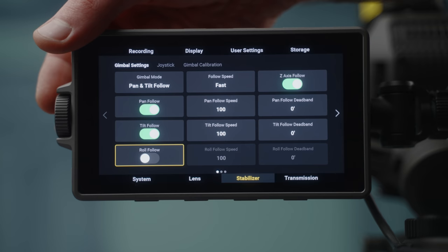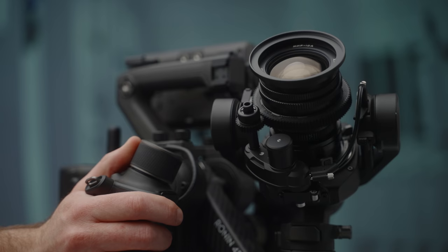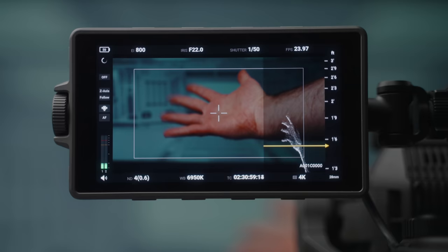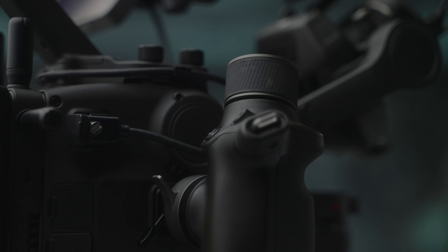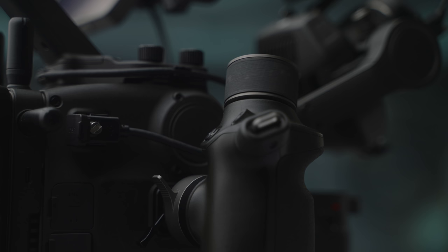All of these settings can be customized, tweaked, and saved in the menu system. Next up: LiDAR and focus. The Ronin 4D uses the LiDAR rangefinder to read your scene and then uses that information to either focus the lens automatically or display it on a focus waveform for manual control. There are two autofocus modes: AF and AFM — AFM turns on autofocus and turns the focus wheel on the grip to match your lens movement. You can take manual control of focus at any time and just let go to hand autofocus back control, which is brilliant.